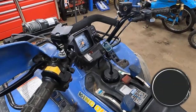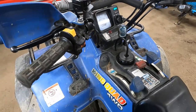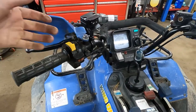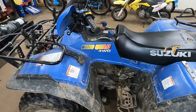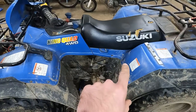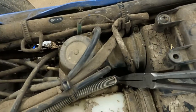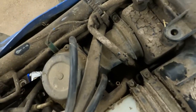My papa called me and said this wheeler had been sitting for a couple weeks. He went out to start it one day and it wouldn't fire up — the lights work, it rolls over, just won't light. I'm thinking this is probably a fuel pump issue. These King Quads have a fuel pump because the motor sits so far back. We pulled the fuel line off the carburetor and there was no gas in it, so that's what led me to this point.